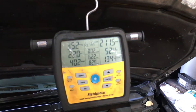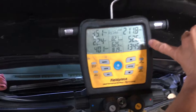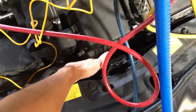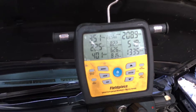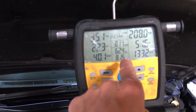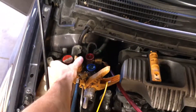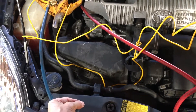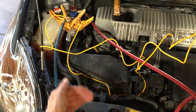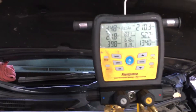Way overcharged. Don't look at superheat because we're on an expansion valve system — if this was an orifice tube you'd use superheat; if it's an expansion valve you use subcooling. I have a steady airflow, compressor constantly running, and the fan on inside. The suction line temperature right now is 62 degrees, and the liquid line attached is 81 degrees. If you move your liquid line clamp over to the discharge line before it enters the condenser, you usually have a 50-degree or less temperature difference — if it's more than 50 degrees there's a problem. That's covered under another video.